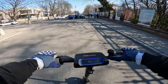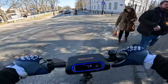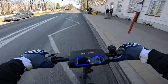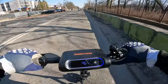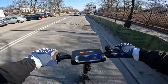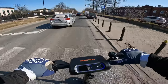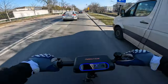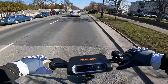Let's start with safety. The battery management system on the InMotion S1 is okay — it's a passive BMS, so nothing special here. I would really like to see a smart BMS like we can see on Xiaomi's and Ninebot's, where you can check individual cell voltages. With a smart BMS it would be easier to see the condition of the pack and prevent further damage. Maybe that's something InMotion could add in a future revision. In general, InMotion does focus on safety, and their electrical setup in their electric unicycles is usually very good.